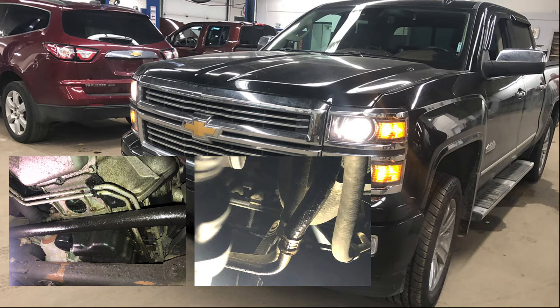This is a 6.2 engine and an older Silverado, so it's got the 8L90 transmission in it — the 8 speed. There are various different bulletins on delay in reverse: one is the 16NA364, and then the 16NA014.